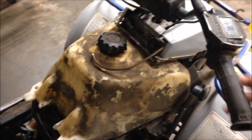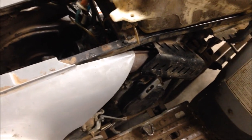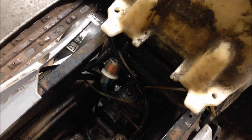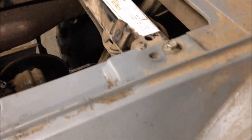You can see when I let off the throttle you could hear it kind of wind out — I'm pretty sure it's got an air leak. Pull the clutch off, pull the rewind off, and then run it and spray some gas behind there to see if it sucks in the gas and dies down the motor. I'll show you how to do all that. I'm gonna start by pulling off this outer clutch cover and remove the bolts that hold the fender on.